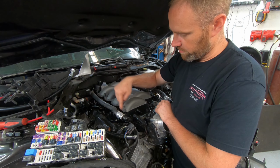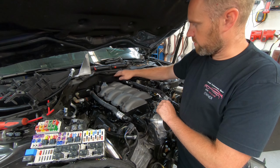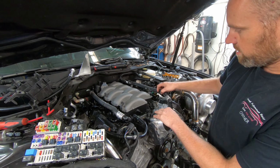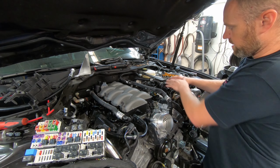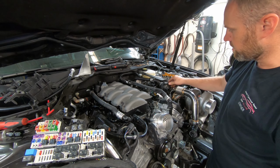It'll go in here for the low pressure side, come down the rail, up over here, well, I mean, a little shorter. It'll clear everything I need it to clear, come into this fuel rail, over to here, and then this 90 degree comes up, and I'm going to make sure that this has plenty of room. I might even make it so loose that I'll twist it when I tighten it down so it folds over this way on top of this thing, or towards this thing.